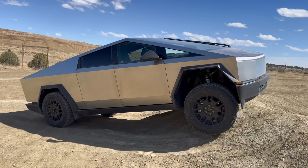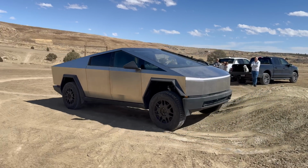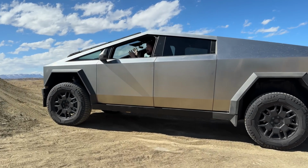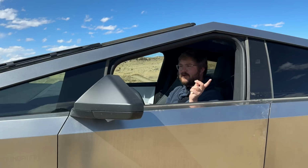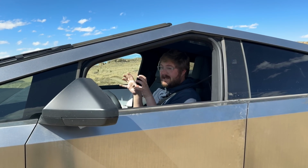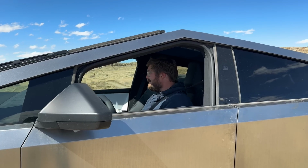And here we are up the obstacle. So this is pretty good as the time stands. A locker certainly would help eliminate that front right tire spinning and needing to use the brakes. I'm also not hearing the ABS pump clicking away like I was in the other vehicles. Both of those have brake-by-wire. This is a physical parking brake and it can just kind of clamp down on the brakes right there through ABS, although again, not hearing it.